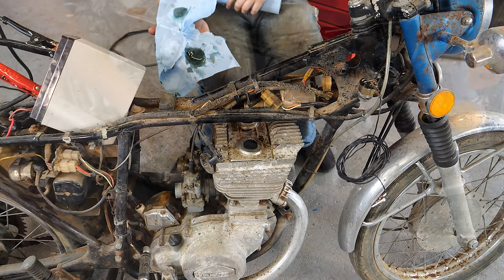All right, next up is the key. Finally get the new one in place. We've got two screws on the back of this headlight, one here, one here. Yes, there it is. It is this guy right here. Orange, gray, and brown. All right, there's our key out. Clean up the one from the parts bike a little bit. There we go, new key plugged in. Just gotta finagle this back up into place.